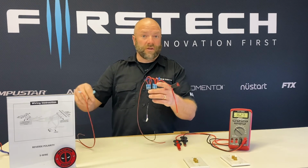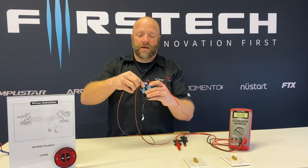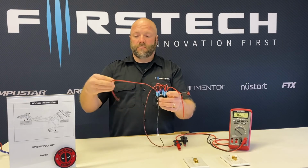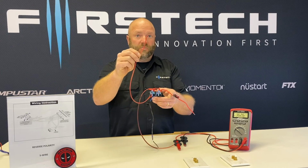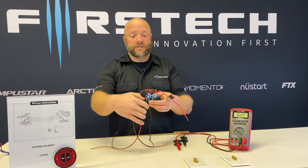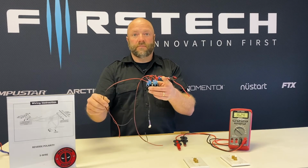So you'll do that for the lock and the unlock motor wires in the vehicle. We'll denote that by showing just these bare wires would be connected. I've got black at pin 87A, so black would be switch side. Red is pin 30, that's motor side. Plug this into your brain, give yourself 12 volt constant input, and you're all set.